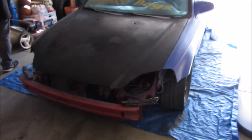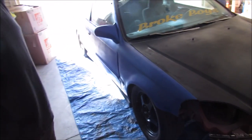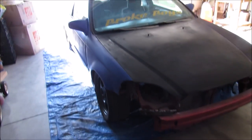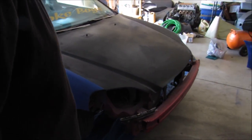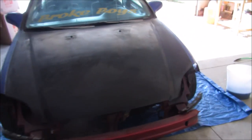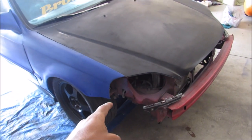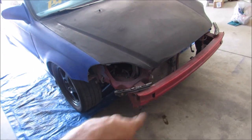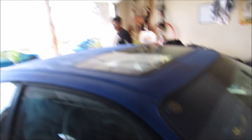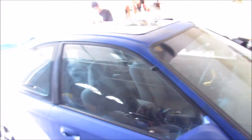The headlights are out, the tail lights are out. All that's left for prepping is a little bit more sanding and then all the glass, and that's gonna be done for the prepping. Now I'm gonna mask off everything — put some paper in between all that so it won't get any overspray, and also tape off the windshield and the wheels.